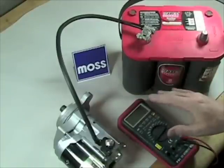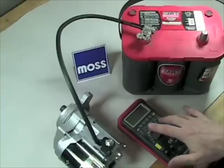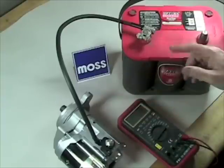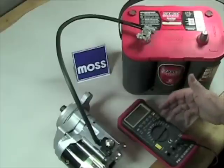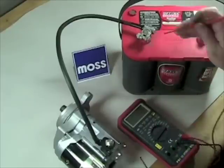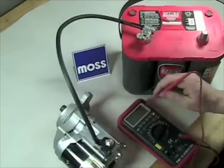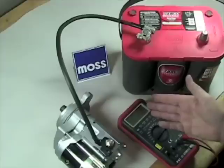Now, with the other systems in the car, one half of one volt is about as much as we want to see through this meter. We've got a lot of electricity going through here, so in this particular case you can get it up to pretty close to one volt and still be acceptable. If we're getting maybe four volts trying to go through our meter, something's wrong.